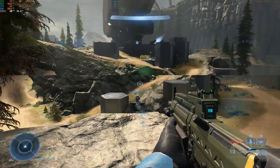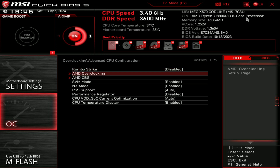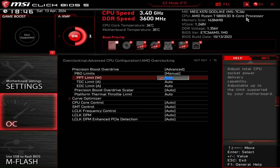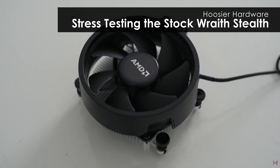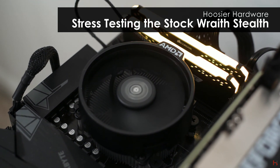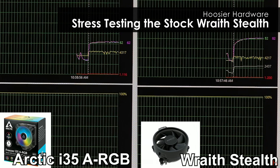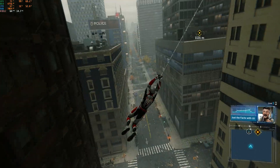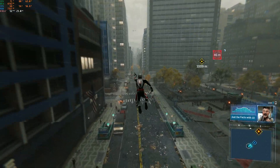However, we want to keep our power down for this build to better match the Series S and reduce cooling requirements. We've got two different options to tackle that: we can either set a static 3.8GHz clock speed or hard code our TDP from anywhere between 50 to 60W. Speaking of TDP, I'll be using the AMD Wraith Stealth cooler, mainly because I already have it on hand from one of my 2400G processors, but primarily it's really short at 50mm in height, and that fits perfectly within our case.